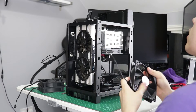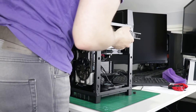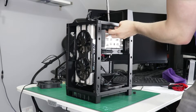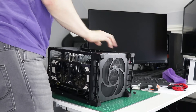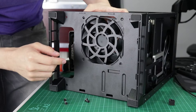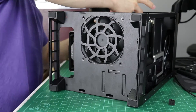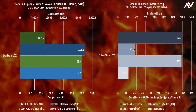A couple of points on the fan-swapping experience. The top fan can be tricky to get out depending on the cooler you're using — if you managed to fit a macho or something similar you'd probably have to remove it first. The lower fan was much easier with no access problems whatsoever. The fan speeds are locked specifically on the CPU and GPU throughout testing, which combined hit 36.5 dBA on an open-air test bench.